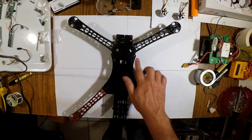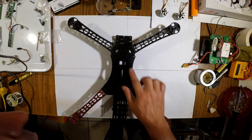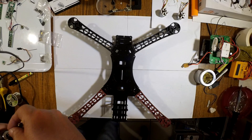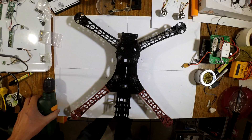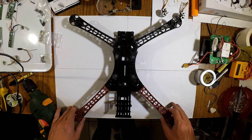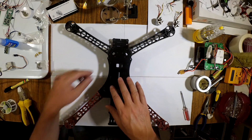What I've done now is drill four pilot holes with a very small one millimeter drill, just so I can get them centered exactly the way I want. The next step is to drill with the three millimeter drill. And there we have it — I actually managed to do that on camera for a change. There's hole number one, hole number two, three, and four. Now that we have the holes drilled...